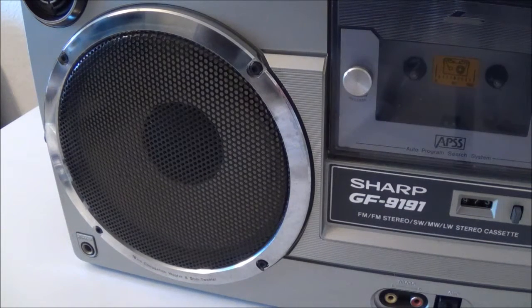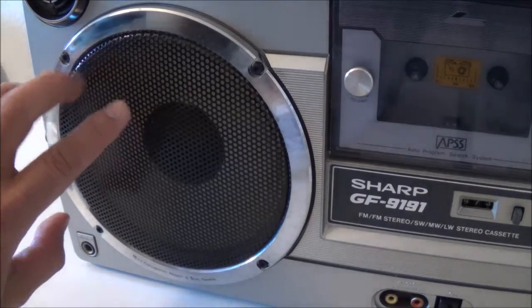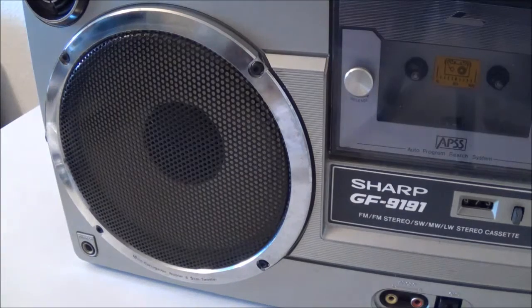All in all, a total of 9 watts RMS. Even though the unit puts out about 4 and a half watts RMS, it's actually still pretty loud. I think that's probably due to the speaker sensitivity being pretty high — some speakers put out more sound pressure for a given input level than others. Because if I turned this thing up, I wouldn't vibrate the walls, but it could sure annoy the neighbors.